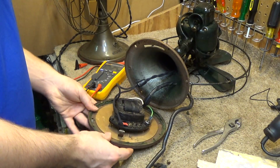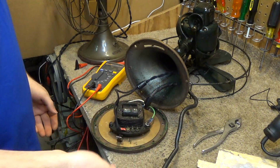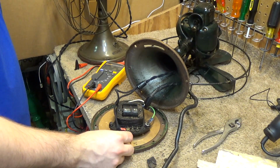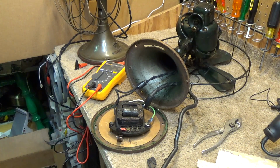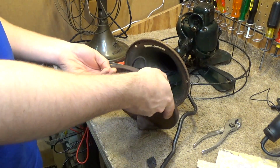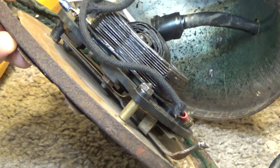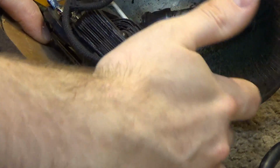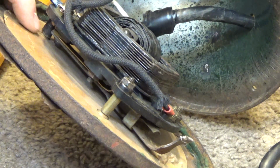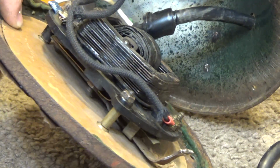The problem with this one is within the switch. The switch was broken, and these are some remains of it, but this would usually have a plastic cover that goes over this piece. Without that plastic cover, this is very dangerous to use, because with the way these switches are designed, this bar here that you're using to manipulate the positioning is contacting the mains, which is being fed to these three different selections on the right side. And so this handle here is actually live.